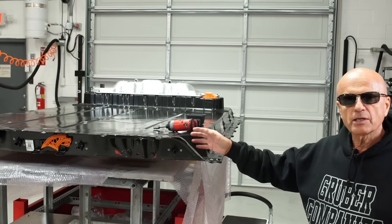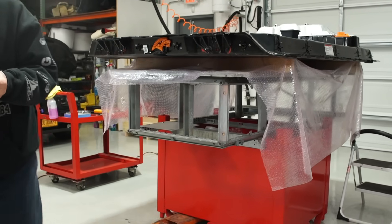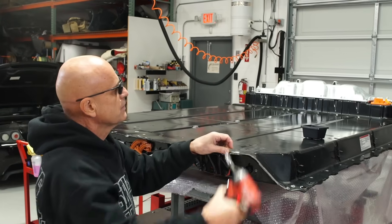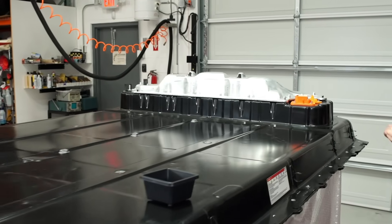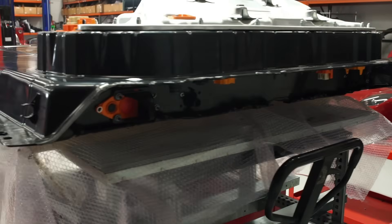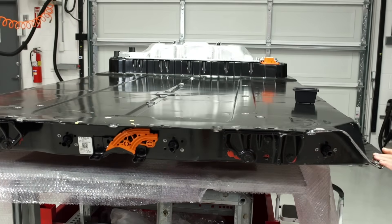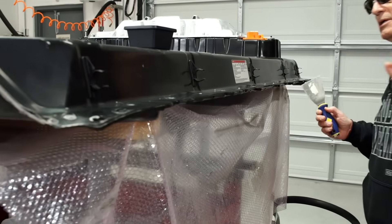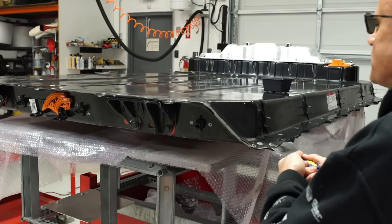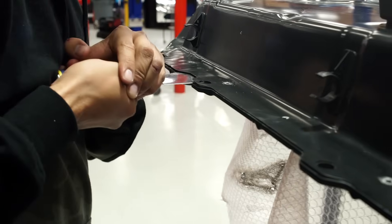The pack weighs about 850 pounds. We have it on a hydraulic table and this morning we're using a six-point E9 socket to take off all of the mounting screws. In the front we have five-point mounting screws on this lid, which is the cover for the high voltage section and some of the logic in this battery pack. Once all the mounting screws for the top lid are removed, the next phase is to break the seal that goes all the way around the battery pack to make it waterproof. We use a putty knife to get in between the top lid and the housing, going all the way across to remove all of that caulk material.